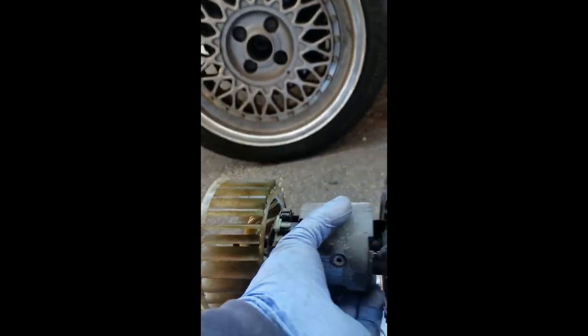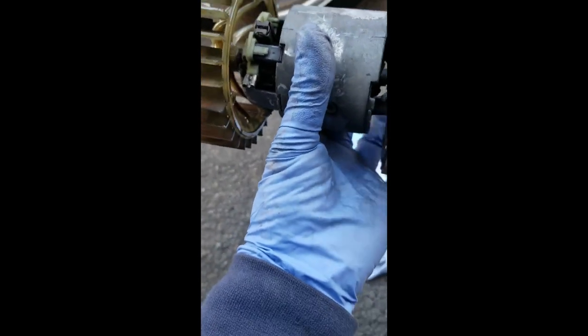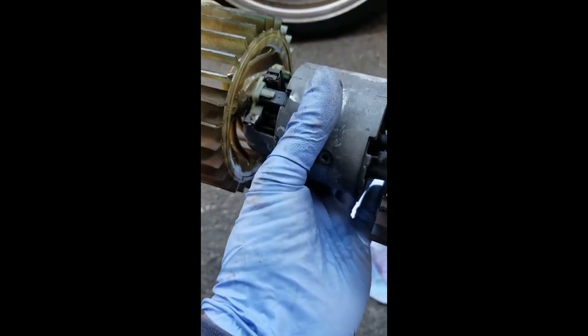As I turn it — I think there was just a little bit of rust buildup inside there that was making the noise. I think you can reuse this — everything works, it blows good, it just made a little noise. Putting a little WD-40 where they connect got rid of that little squeak. Of course at higher speed you hear it less, but at lower speed you hear it more. Anyway, I think it's still a good motor. I'm gonna put it back in.